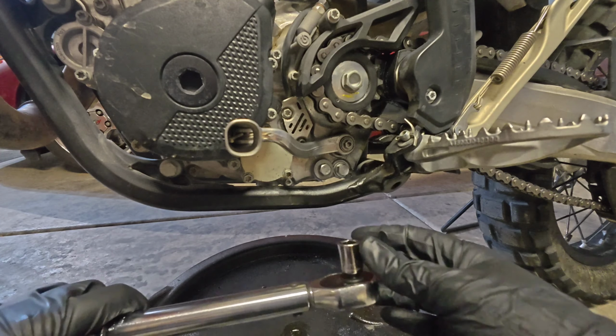This is the first quart going in, but if, let's say, you're going for that fractional portion of the next quart, you could overfill it. So it's important that you go slow, because that way you can see it coming up the sight glass and you can back off. It takes a second for the oil to go down the clutch plates and get into the basin down there, into the sump. If you overfill, you could quickly overfill, and then you have to remove it, which means you've got to drop one of your plugs on the bottom. Turns into a big old snafu. So just go slow.